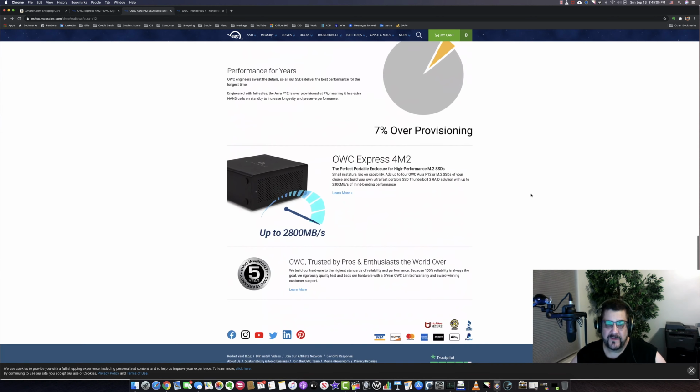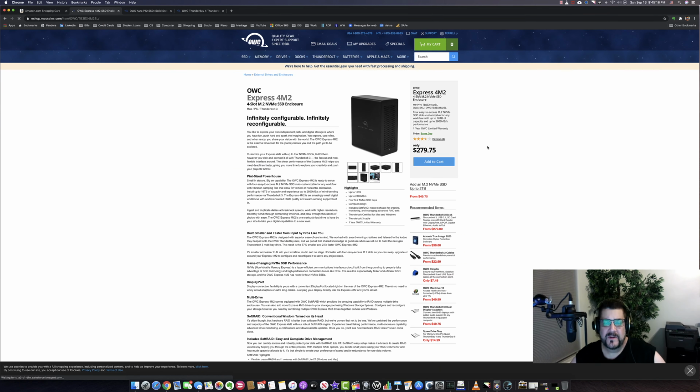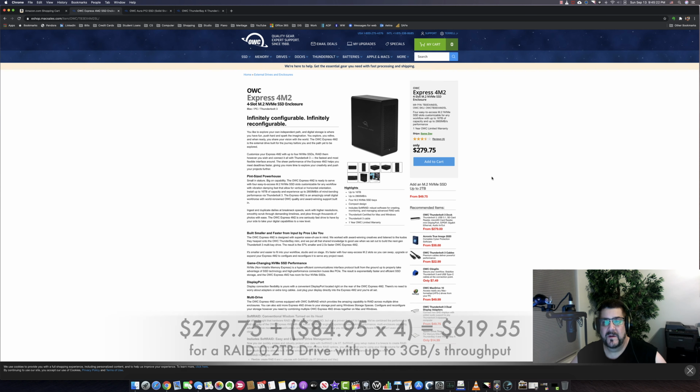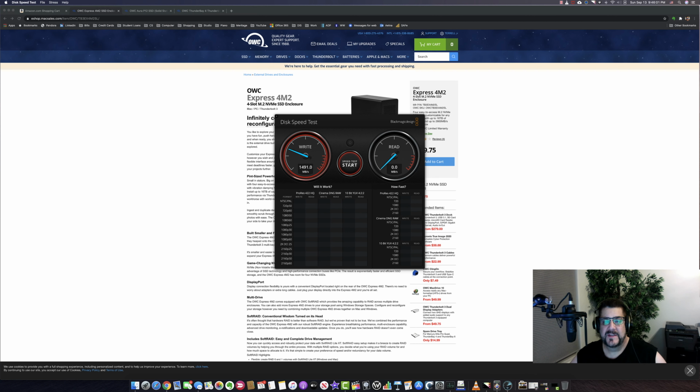So what you do is you get four of these and then you assemble them yourself. And the drive itself, if we go over here, the enclosure is only $279.75. So $279.75 plus 89 times 4, and you have a screaming fast scratch drive for your video. How fast? Well, I'm glad you asked. So this is Blackmagic. So basically 1.5 gigabytes per second on the write and 2 gigabytes per second on the read. And that is incredible. So that is my scratch drive that I built myself using the Express 4M2 SSD enclosure together with 4 Aura P12 NVMe cards for like $87 each.